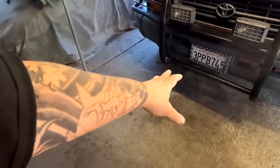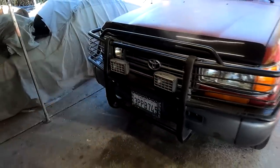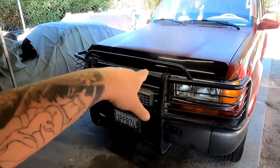Now the hose looked like it's literally the same hose from factory in 1996. And it was very, very bloated. So what had happened was when I put the fan shroud in, it kind of kinked the hose itself and caused a little tear, which then every time he would drive or turn on the vehicle, it would piss out ATF on the floor. I went over there, I snipped it, I shoved it in further, and then I clamped it down and he was able to drive it here. And today I need to button it up with changing the hose out and then fill up the transmission, and then we can get this off the driveway to work on that.